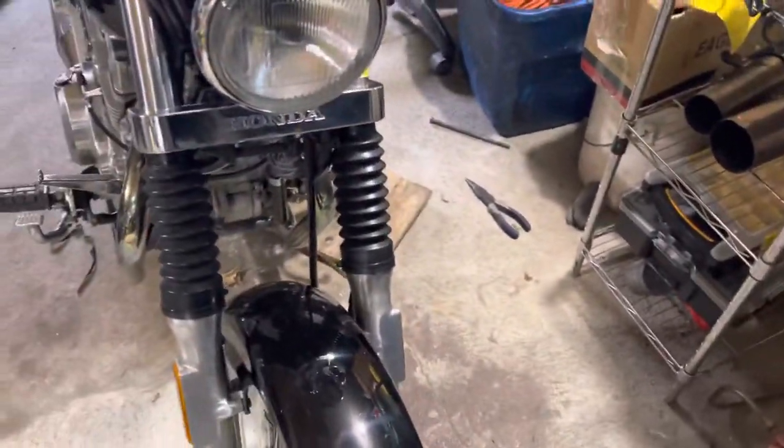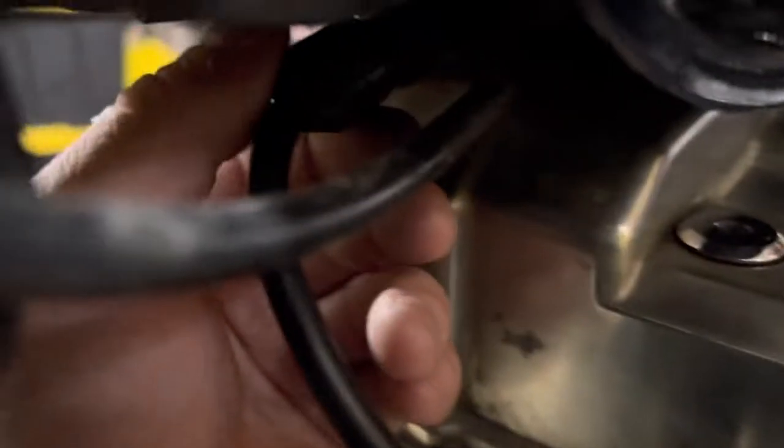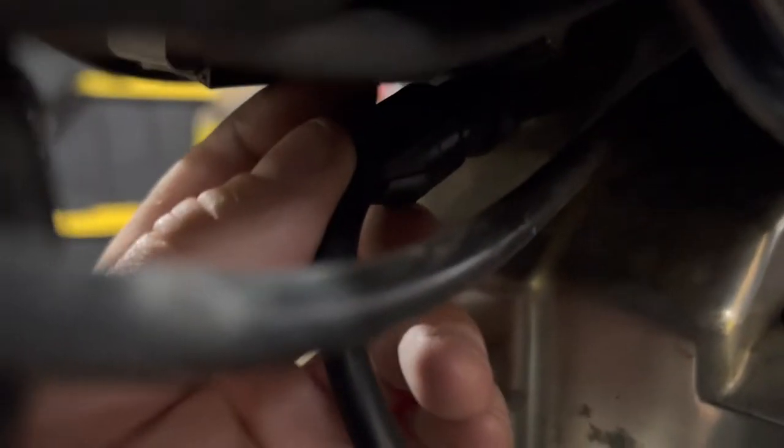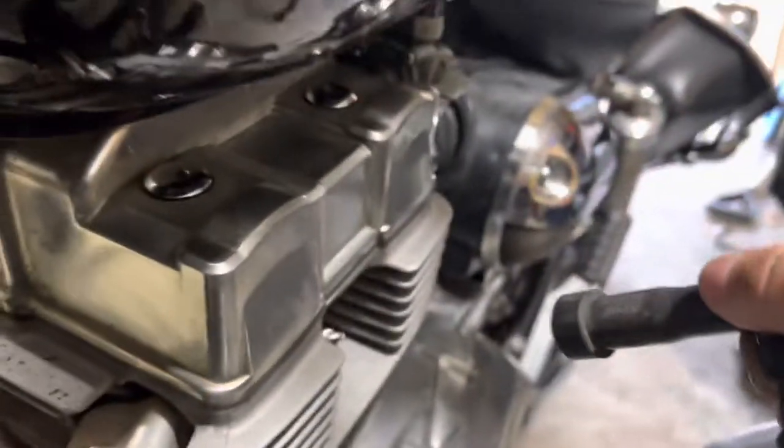It's not your traditional way of how you would rewire a spark plug wire. On this Rebel 450, you have the coil and it has this piece that plugs into the coil and it's threaded on, as you can see. You unthread it — this takes it out of the coil. I have this one in the bottom, but the left side goes into the top part of the coil. It unscrews and then the wire just pulls out, and that's all it is. Then your spark plug obviously comes off like that.